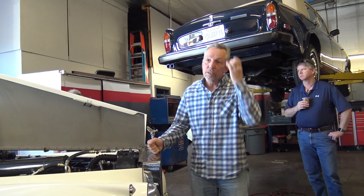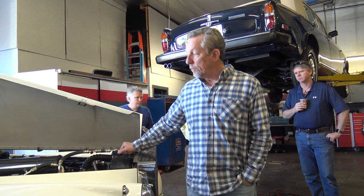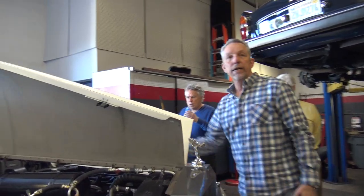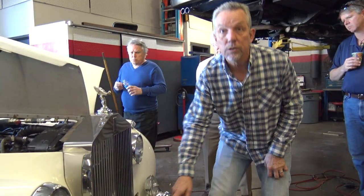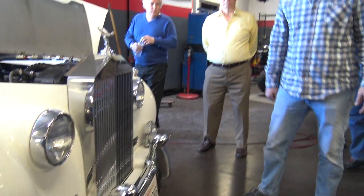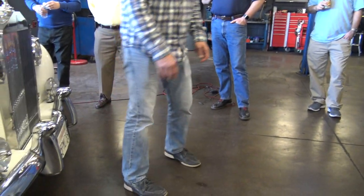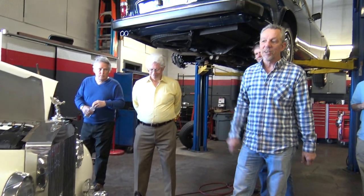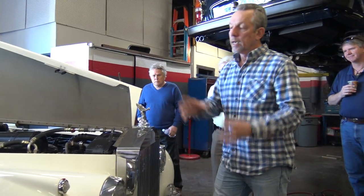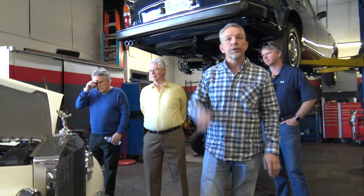The SilverCloud 1s on the heating system have a heater core in each wing. In the fender areas, up inside, there's a duct that comes from openings out here — a strategic location. They weren't designed for stop-and-go traffic, because the car in front of you has its tailpipe right there, pumping exhaust fumes into your car when the heater's on. There's a ducting system with a blower inside the fenders, little heater cores, and then plastic ducting in the dash for your heater and defrost.